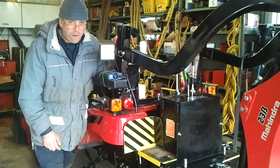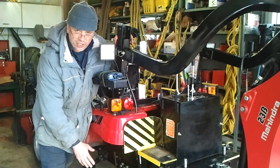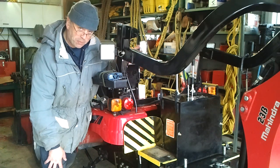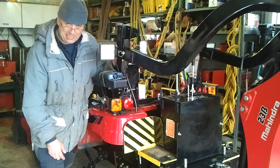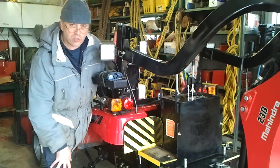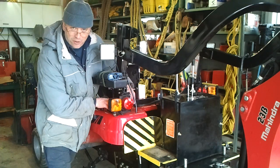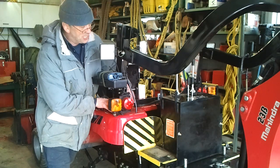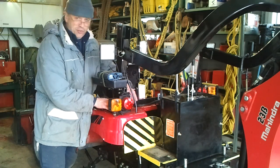All right, gentlemen, so you can see that I was paying a lot of attention under here. I had only one bolt loose. I completely forgot yesterday when I retorqued, no, 2 days prior. But one thing, I never retorque since 200, and I don't know, I'm past 200 hours, but it's time to torque these bolts there. This is very important. It's the ROPS, rollover protective systems. So they were loose. So now they're very well torqued.